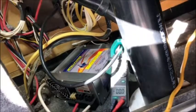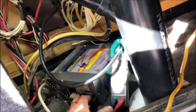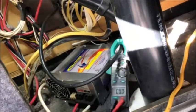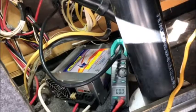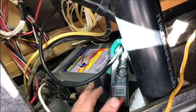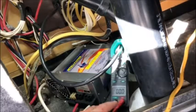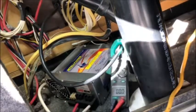If you've got 120 volts going to the charge controller, try unplugging the negative side and measure whether you're getting 13.5 or 13.6 volts coming out of the charge controller. If you're not getting that, it's probably a bad charge controller. The last possibility is a short in the battery. Disconnect the battery and just run all your 12-volt circuits directly off the converter charger.